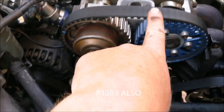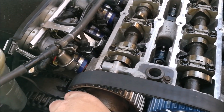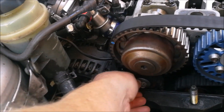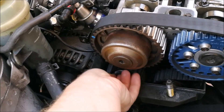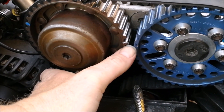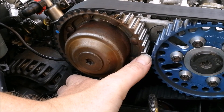Say the belt is all on. The VVT pulley will free-float - watch: I'll turn this now and watch the cam, it'll stay exactly still. See that turning movement? That's because the VVT mechanism will turn. So if you've just had your belt fitted and you do up the tensioner, watch now as I pull this tensioner by hand - see the pulley tightening up? Now if you look at my white marks, they're out of sync. If you now tighten everything up and run the engine, you're going to get the over-advanced code because it's already misaligned.